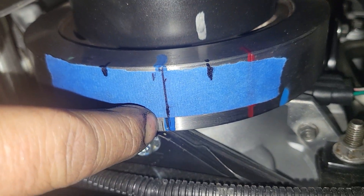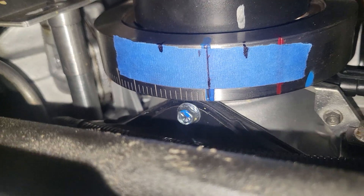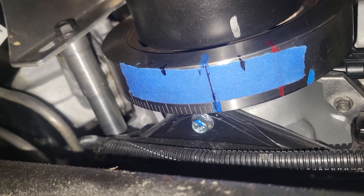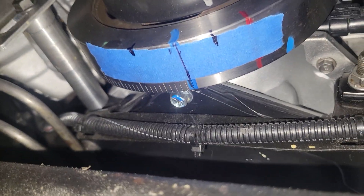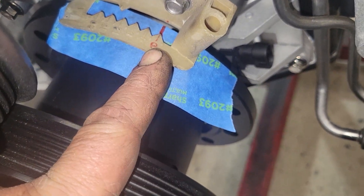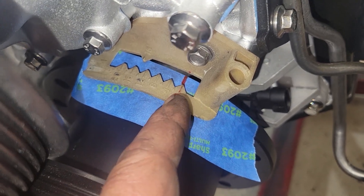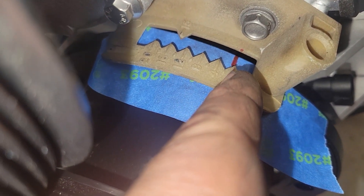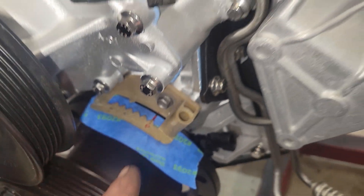On this particular engine it's about a degree and a half advanced before top dead center, because my red mark is my cam sensor mark which is 25 degrees after top dead center. In my crank reference angle I'm not going to adjust for this — I'm actually going to adjust for it on the pointer. I'll bring this mark up to the new mark, which is probably going to be right between the valley and half of the peak, and drill a small hole and make a mark.